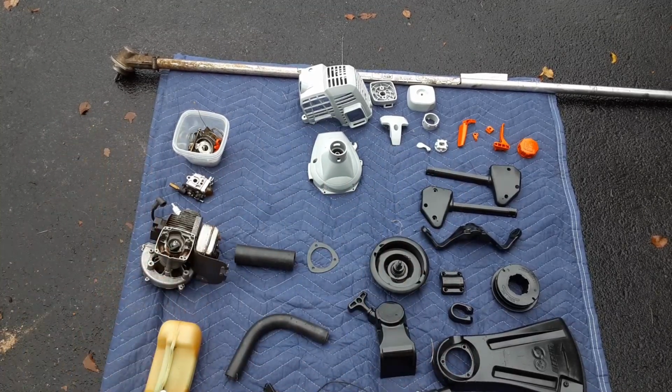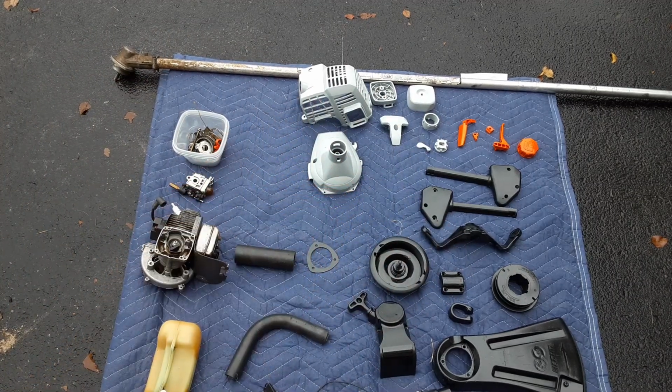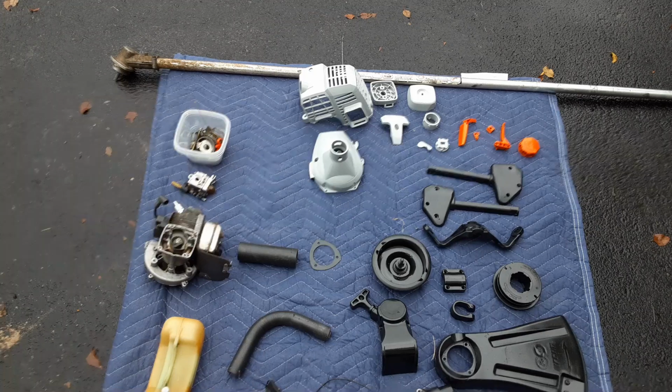So what I'm going to do with that is I'm going to take my sudsy stuff and I'm just going to go ahead and clean along the shaft. And then I'm going to take a wire wheel to the shaft, and then work my way down the sandpaper grits. Start at, let's say, 600 and then go 1,000, 1,500, 3,000, and then 6,000 and 10,000. So that's going to be a long process that you're going to watch me do with the time lapse. So let's get to it.